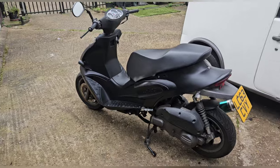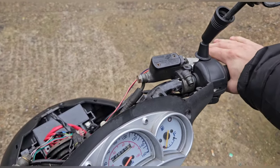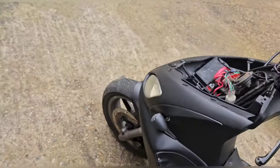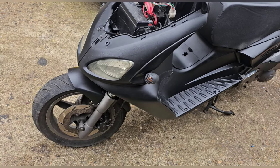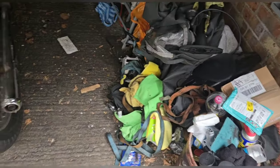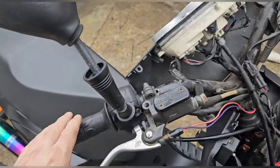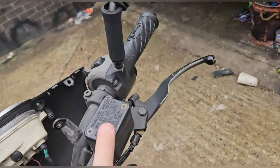The next day - hi everyone, welcome back. Last I left you, we tied down this brake lever and that hasn't stiffened the brake. So currently this brake is working - it's a working brake - but what it's not doing is being solid, not rock solid. Considering the DOT 4 is 6 years old, I'd probably go there next - draining the old out and putting new in. I might undo the bottom banjo, catch it all in a container and then suck it through or even reverse bleed some fresh stuff in and see if that makes a difference. Otherwise I'd be looking at a new master cylinder - something just doesn't feel right about this one. In fact, looking at it - is that even the one that came with the bike? It doesn't look like it, does it?